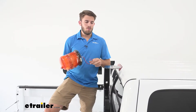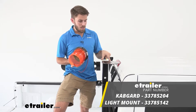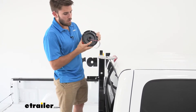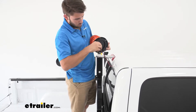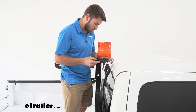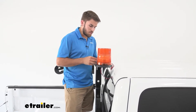To begin your install, you want to pick a spot to mount it — whether it's on the cab of your vehicle. In our case, we're going to mount it to the beacon light bracket attached to our cab rack. We're just going to feed our wire, since it's coming out of the center of our light, through that center hole. Then we're going to line up those three bolts to the three slots on the outside and drop the included hardware through our light and through the slots of our bracket.